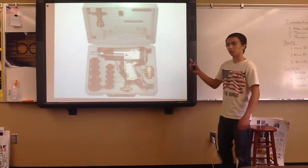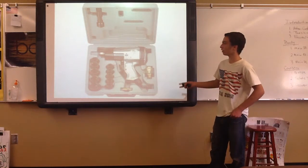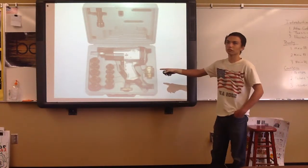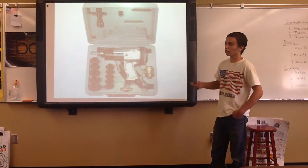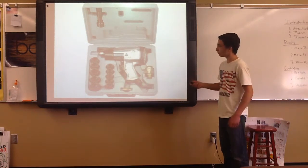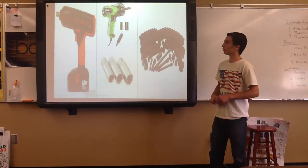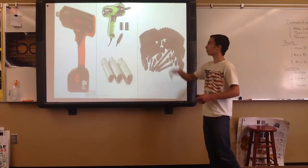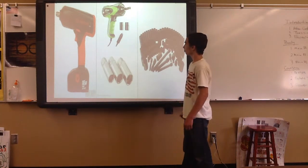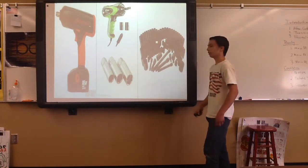There's an impact wrench, and this is good for bolts that are fussy or rusty because it has a lot of torque with older engines. These black sockets are made especially for impact use because the force on the bolt and nut could split a regular socket right in half. There are different types of impacts — a battery-operated one which I prefer, but it's a pain when it's not charged. There's also an electric one, which I'd highly recommend if you've got an extension cord. These are extensions especially made for the impact.